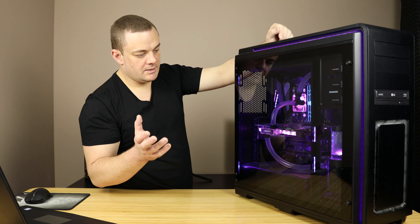The next thing we're going to do is drain the loop of any water currently inside it. I'm going to turn the case around — I've put a drain valve in. When building a custom water loop, always put in a drain valve; it makes it so much more convenient. I have a fitting that converts to a spigot so I can connect a piece of tubing and run it into a clean jug to inspect the coolant as it comes out.